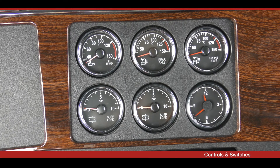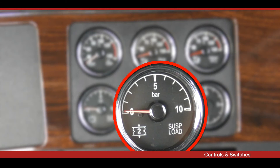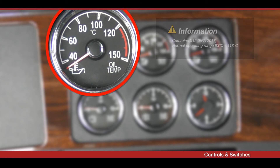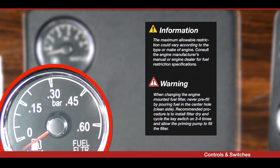When the vehicle is equipped with dual leveling valves, the number one gauge indicates the air pressure in the driver's side airbags and the number two gauge indicates the air pressure in the passenger side airbags. Drive axle temperature gauges indicate the temperature of the lubricant in the axles. The engine oil temperature gauge indicates the engine oil temperature; see your engine operation and maintenance manual for details on your specific engine. The manifold pressure gauge indicates the power your engine is putting out by showing the amount of turbo boost — if this pressure goes down, there may be something wrong with your engine, so have it checked by an authorized service technician. The fuel filter restriction gauge tells you the condition of the fuel by indicating the restriction from the fuel filter to the fuel pump.